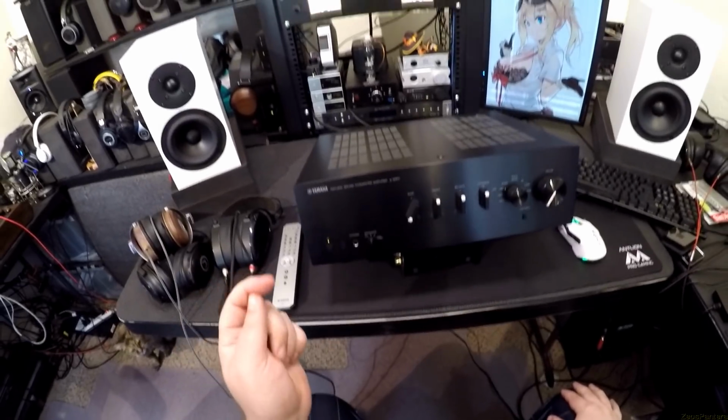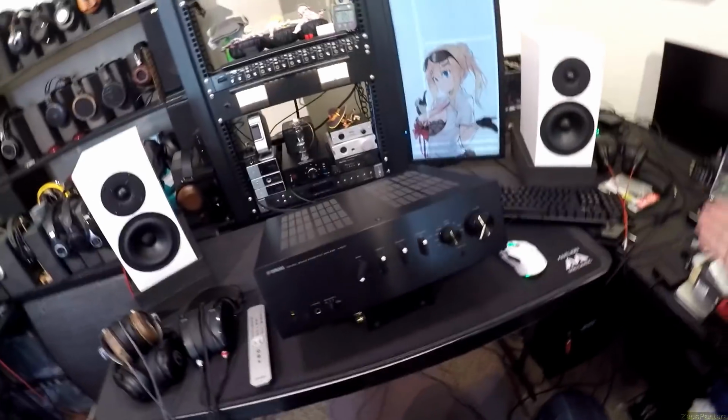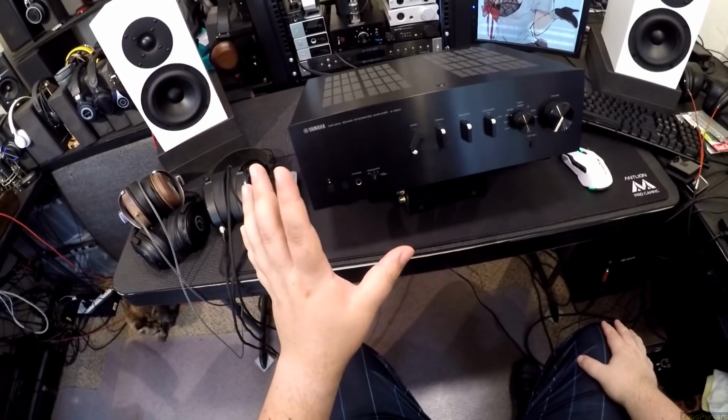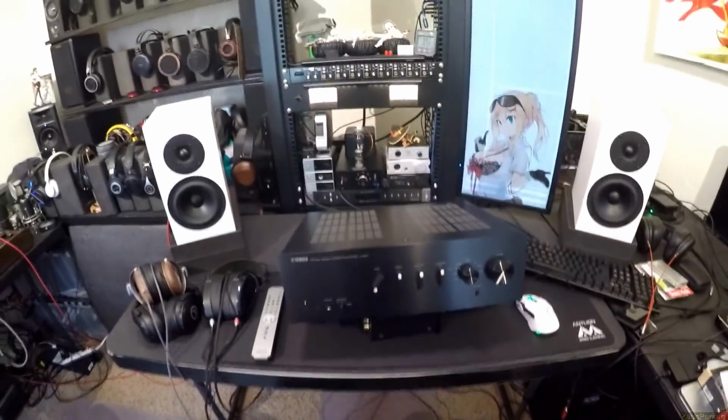The issue is, when you have a subwoofer, you don't want the speakers you're trying to drive to also try to do bass. They've been trying to do bass their whole life. When you get an actual tunable, like the PS Audio Sprout 100, when you plugged the subwoofer into that, it went click, and then started playing without bass in the speakers, because it was going down to the sub. So that meant the speakers were free to not deal with it.